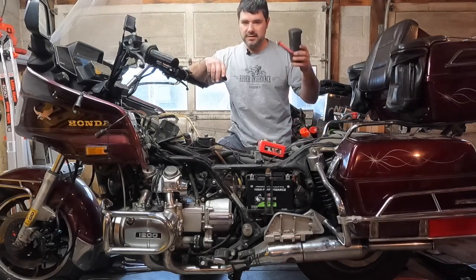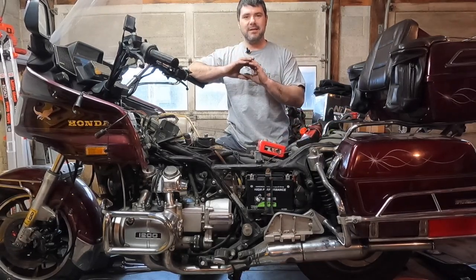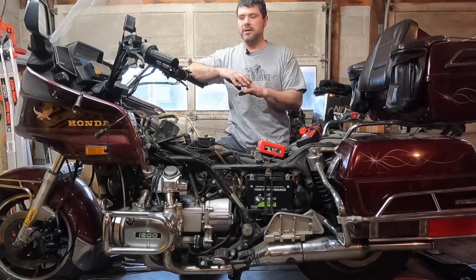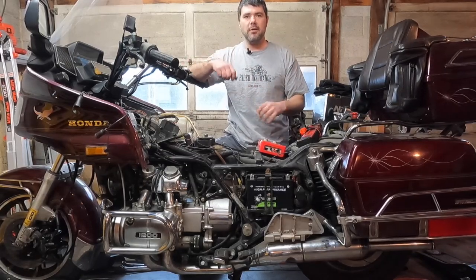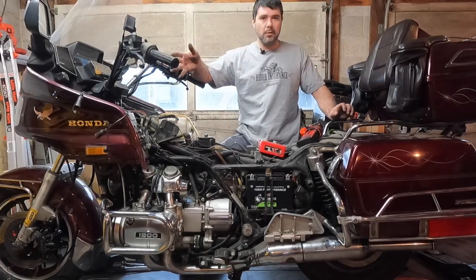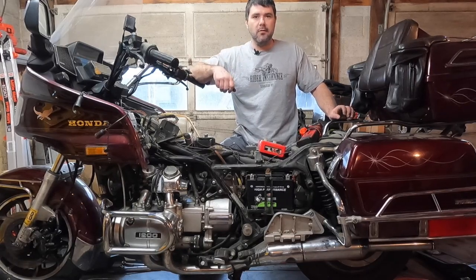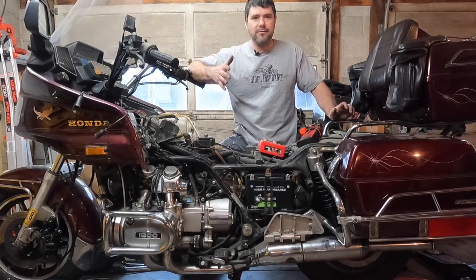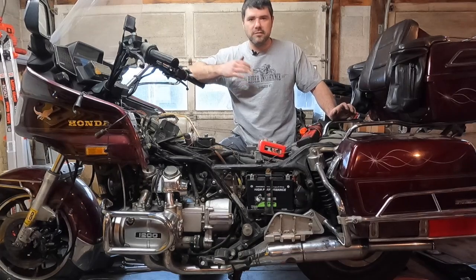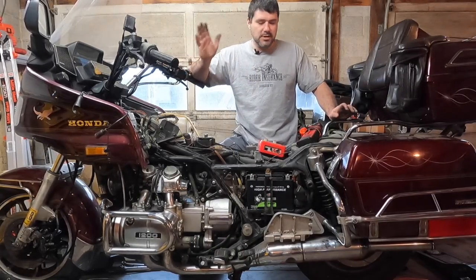So whereas this can't pick it up, this not only picks it up, but it kind of sets a freeze frame of that voltage at a given time while you're cranking something over. So for example, when we're testing the pulse generators, when it's just cranking over, I should see a voltage of around 5 volts, somewhere between 0 to 5 volts for peak voltage.